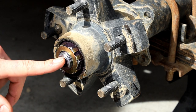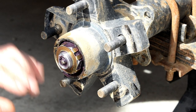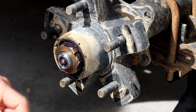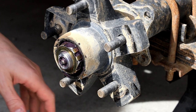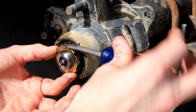The grease nipple, or grease zerk, here, we're just going to leave it. It's a feature of this axle. I don't want to take it out. We're simply going to change the cap so it quits slinging grease everywhere. But if a customer does want to grease it, you can pull a cap off and fill it there. So, without having all my stuff blow away, I apologize for the wind noise. All we're going to do is get behind this guy.